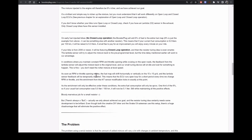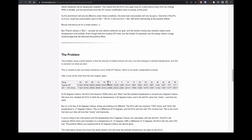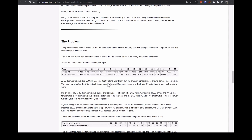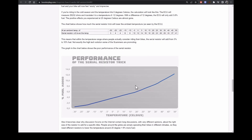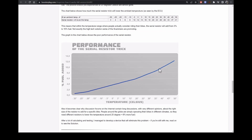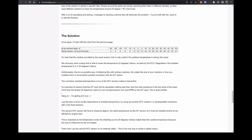The problem is that because of the non-linear resistance curve of the stock sensor, everything goes a bit wacky. You just can't put a static resistor in and hope for the best. The graph below shows the poor performance of a serial resistor — it was too much of a curve in the way it changes the offset. He wants it to be six percent richer across the entire range, but because of the way the sensors work, it ended up being way more — none, two, six, eight, ten, twelve percent. You don't want that; you want a nice flat six percent added across the curve.